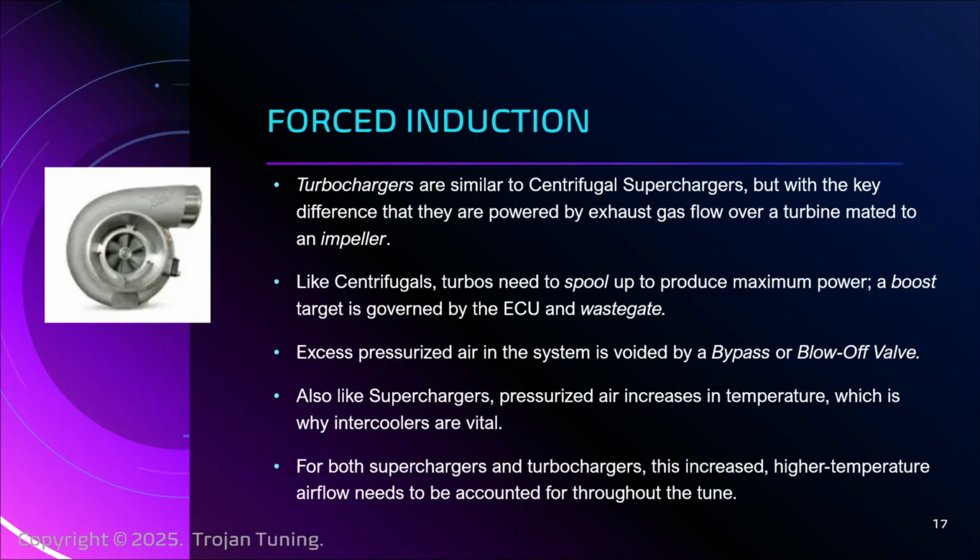What does that mean? So we're going to look at fuel ratios next time. You remember I was saying I need like 14.7 molecules of air for one molecule, or oxygen rather, for one molecule of gas. With ethanol, 10%, we know that it's actually about 14.0 or 14.1. And so when we're doing regular driving, we command a target air to fuel ratio of about 14 to 1.